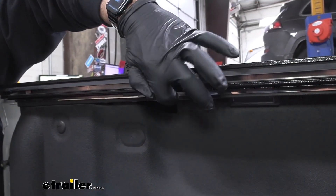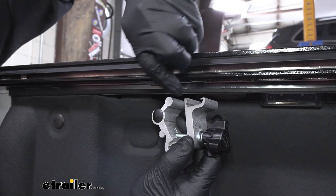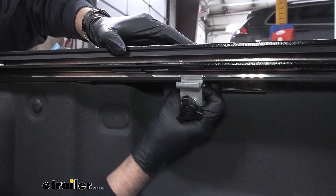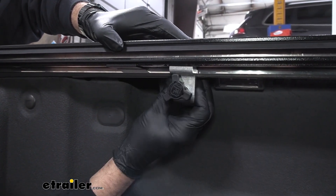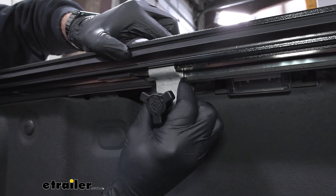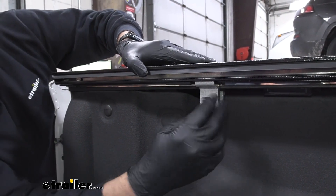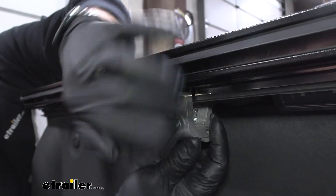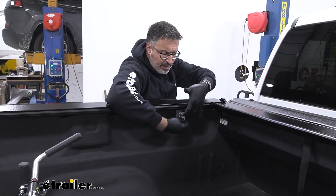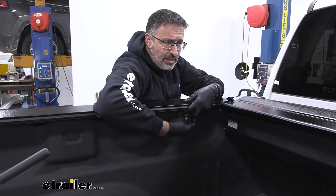Under the rail there is a notch where these will attach. The easiest way: you'll see a notch here and here — that's where it sits in the rail. Start by attaching the underside of the rail at the notch. This truck is equipped with bed lighting which makes it a little difficult, but once you get the back side seated, the front side will go in and you pull it back towards the block where the shim is. Then tighten it down, but don't snug it yet. Do this at all four points on the truck — we're going to square it up after.